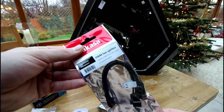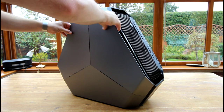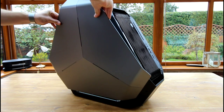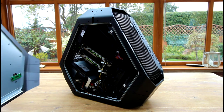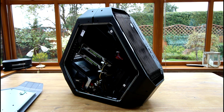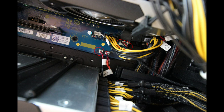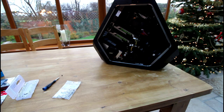You will also need to remove the bottom support plate that stops it from being pushed over, to turn it onto its side and get to the bottom PCIe bracket screws — more on this later. Once everything is protected surge-wise, you can remove the left side door to access the internals. Before we start removing fans, we need to unplug the fan header connections on the board.